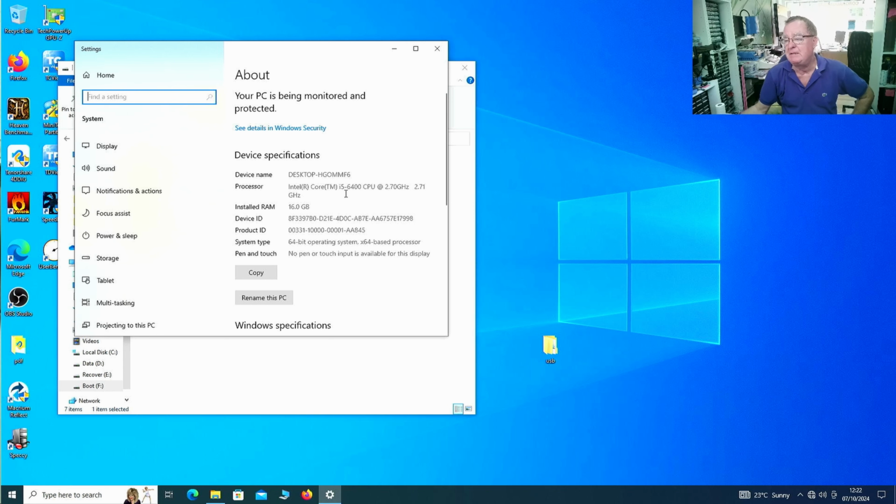While we're here, let's just have a quick look at this power supply that came with that other computer as well. The light bulb's in series again. Let's see what it does. Wait, it ain't going to go bang again. In fact, it's going to power up. I can see that. So, switch it to mains. The analyzer says it's good. Okay. So it looks like we have a good power supply as well. Could be handy, 600 watt, okay.